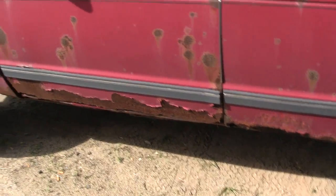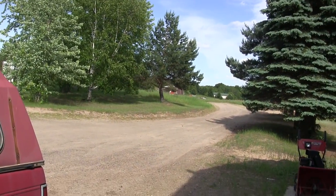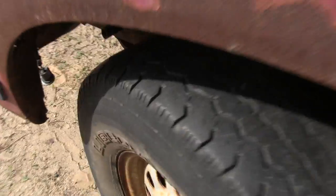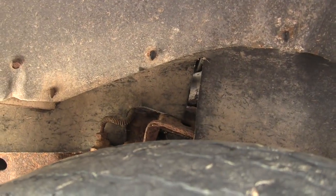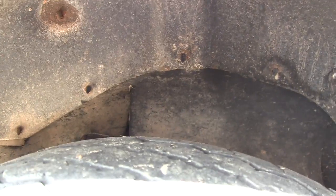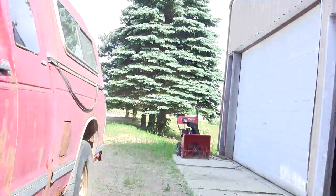Well, I went ahead and I put air in the tires and put a little bit of transmission fluid in it and a little bit of brake fluid in it, and went ahead and drove it down the road there and realized I still had no brakes, no pedal. I did find the leak though. It's way down here by the frame. I don't know if you can see it. Move that there. It's in the line there. So I'm going to pinch that off.